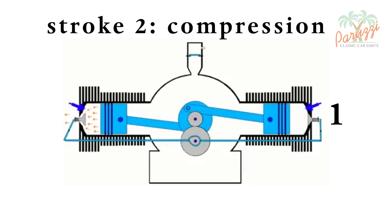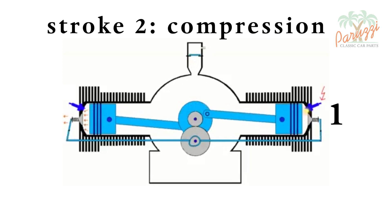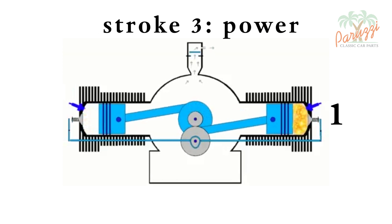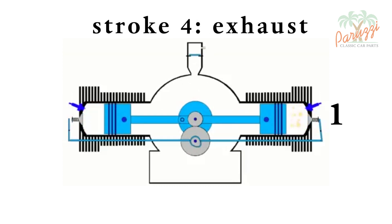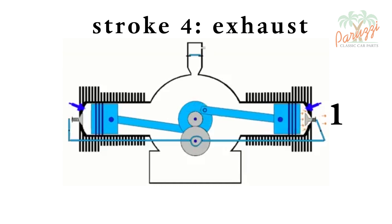The second stroke is the compression stroke. During this stroke, both the intake valve and the exhaust valve are closed and the mixture is compressed. At the end of stroke two, the spark plug ignites — the mixture explodes and pushes the piston away. The third stroke is the power stroke, where the piston moves toward the crankshaft and the power of the engine is developed. At the end of stroke three, the burned fuel mixture must be discharged through the exhaust. The fourth stroke is the exhaust stroke — the piston moves back toward the cylinder head while the exhaust valve opens to release the exhaust gases. At that point, cylinder 3 is at the end of the compression stroke, still with a two-stroke lead over cylinder 1.